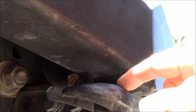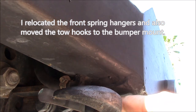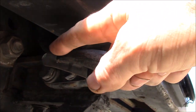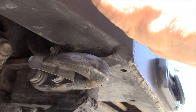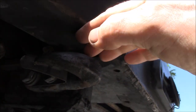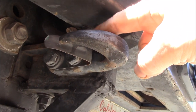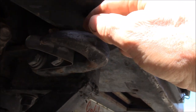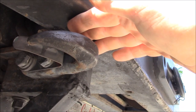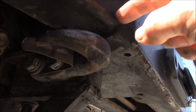Here's where I have tow hooks mounted on my 85 4Runner. This is my custom front bumper mount — I've extended off of the frame in front and then I have a two-inch tall block to raise the bumper up, with the tow hooks mounted on the side. There's an actual air chamber inside the bumper with air fittings right there, and there just wouldn't be any room between the bumper and the tow hook to put one of these d-ring anchors. You need about an inch of clearance between the side of the d-ring anchor and whatever is above, below, or to the left or right of it.